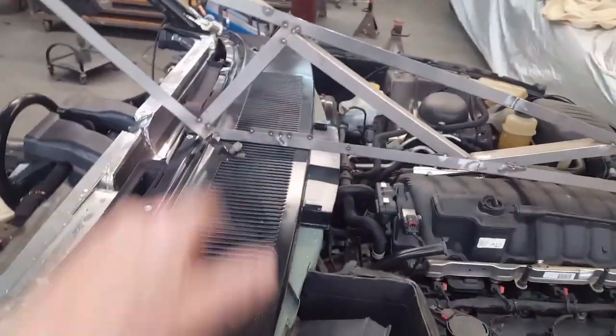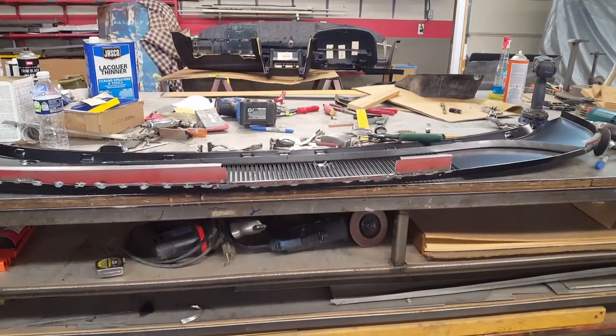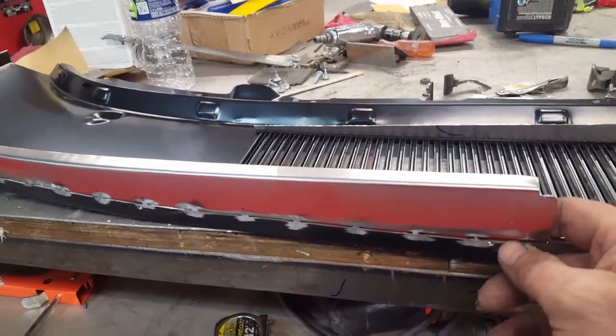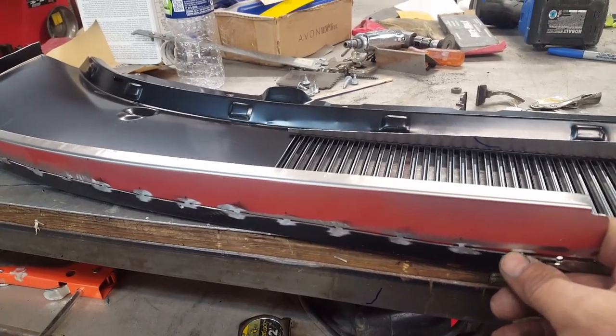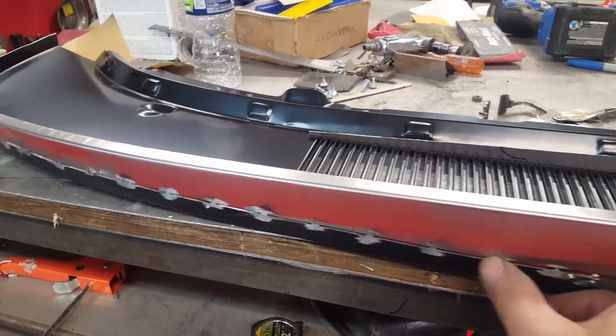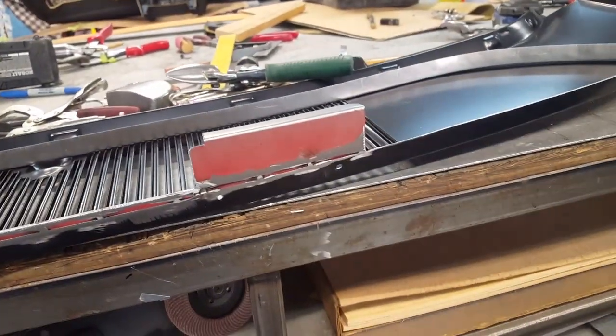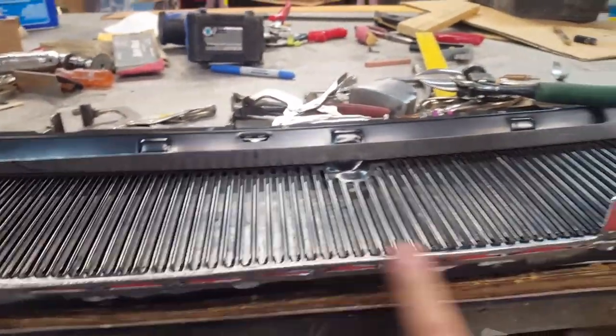That template gave me the profile of the hood as it related to the roof and the cowl — it tells me where the cowl needs to plane off. With the cowl back off the car, I trimmed these pieces up, stepped them on the back side, and welded them up so this panel is now flush rather than overlaid as it was when temporarily screwed. I also filled in a little bit on the top side over the box that conceals the windshield wiper motor.